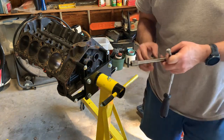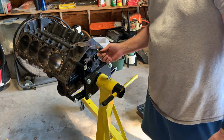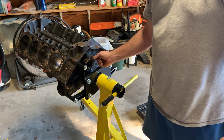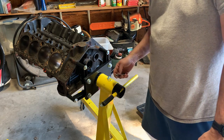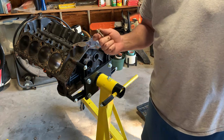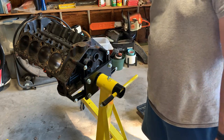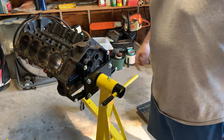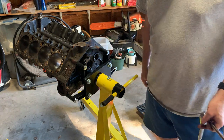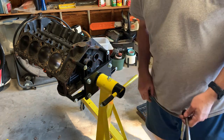So that didn't work either. The plug's pretty short and the material is kind of soft. So tapping it, I was just stripping it out whenever I was tightening down the nut. It just kept pulling the bolt out, stripping the threads that I had cut. So I think I'll just keep drilling it until the plug just disintegrates and I can just pull it out.